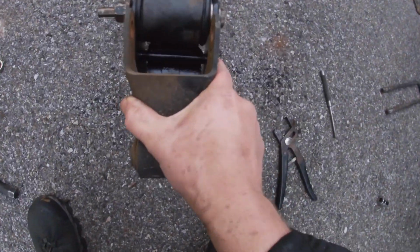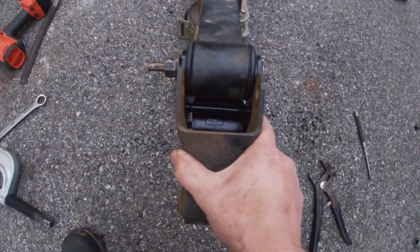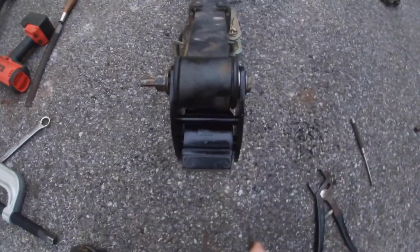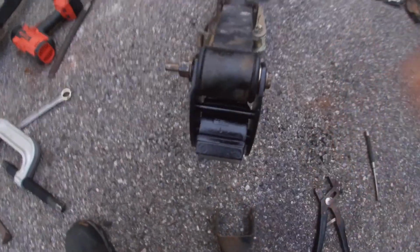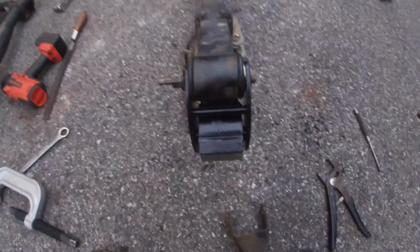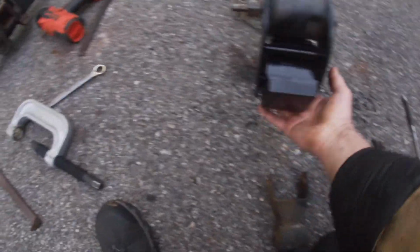So with these Sulastic spring mounts, the kit comes with washers. You need to measure the distance for this portion of the shackle here, and then you'll put one washer that comes with the kit. I guess the directions were a little weird. It says closer towards the center of the axle, and then the bottom will be away from it. I'm just going to put one here and one here, and see how well it does.